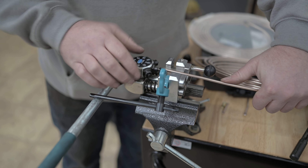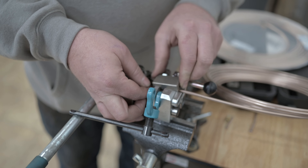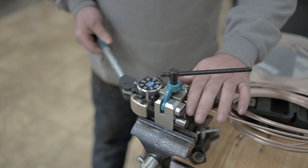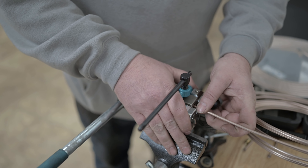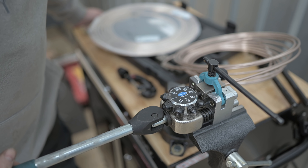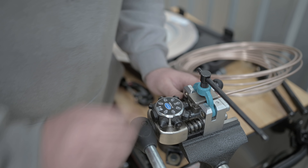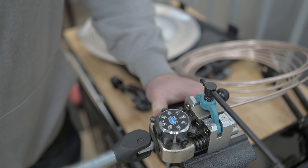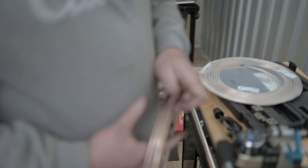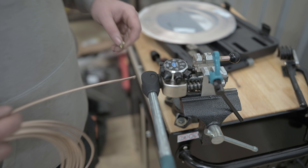Eastwood has a full tutorial online about how to use their brake flaring tool — I'll link that in the description. You just stick the right size dies in for whatever you're doing. Normally you wouldn't be dealing with a 20-foot coil of brake line, but I bought a kit and that's how it came. That first setting basically just gets the line lined up with the end of the die, sets it in there. Make sure the brake line's in the right spot, tighten it down, and now it's locked in and ready for the first operation. Then you yank the handle back — our vise is going to move since this is all makeshift, but it's certainly doing the job. Then you move to operation number two — just give it another yank on the handle, and then you have a nice flare.